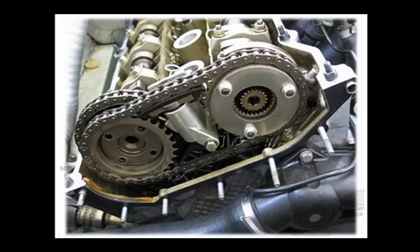All that's really left is the reassembly of the Vanos and firing that engine up. After you've done this correctly, you're going to resolve that bogging and surging. You're going to get a smooth, even distribution of power and RPM transitions, a complete resolution of engine hesitations, and a nice, quiet, stable idle with smooth, easy takeoffs. You're also going to get an improvement in idle when you turn the AC on, and — needless to say — improved fuel economy. Or rather, your customer will.